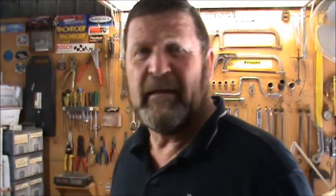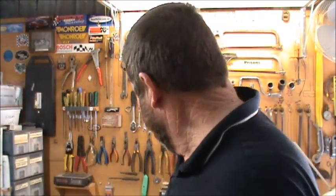Being a metric guy, none of my flared spanners will fit. So I had to buy a set of flared nut spanners in imperial, because the brake lines on this are 3/8. I only wanted the 3/8 but had to buy the whole set — it was only about 22 bucks, so I guess it's not too bad. I've got more tools than you can shake a stick at. I basically have two sets — one up there, one down here. So I'll crack on, start pulling these brakes apart, and I've got the new wheel cylinder to go in — without any further ado, let's get into it.